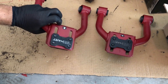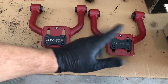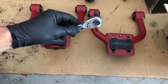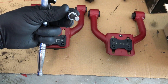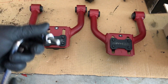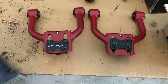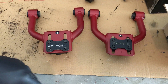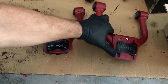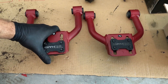I have the right and left camber kit. I took this one off the right side since I did it wrong last time, so I'm gonna switch them out now. I have the right tool to adjust the camber kit — a hex key I also use on my 2013 Mazda 3 for the oil drain bolt. I'm gonna adjust these to about halfway just to get a starting point, since I have no idea what the camber will be, and then adjust from there. This one's a little more than halfway — I'll just leave it and match the other one up to it.